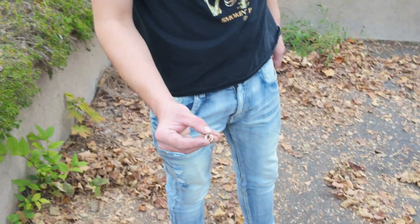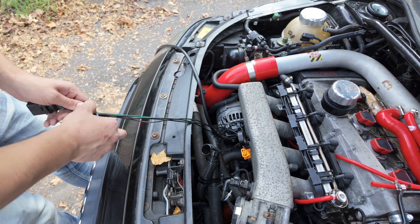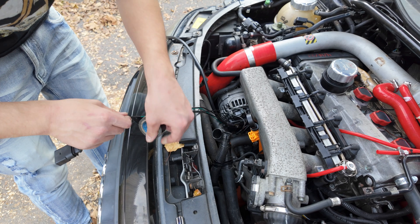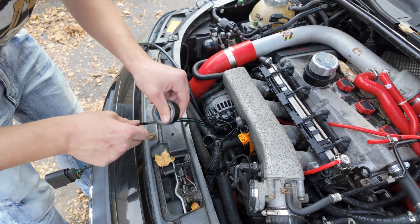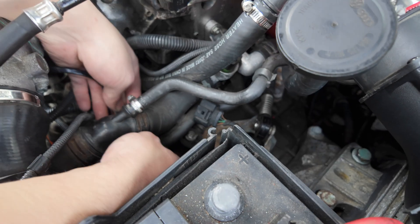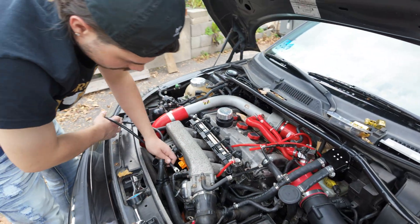Got that alternator bolt. Now we are installing a fresh cable onto the alternator. We pretty much removed the cables that go from the voltage regulator on the alternator — the data-type cables. We removed those from the original harness and we're just taping those up as their own, so we can have that alternator power cable completely isolated, and we can monitor it, easily remove it, and service it as needed. Riley's got this wire all done up and he's just plugging it in. All tucked up nice — now we've got our isolated alternator wire.